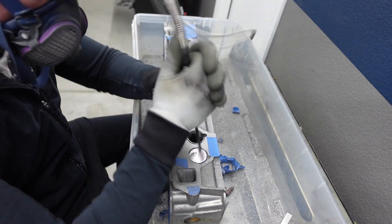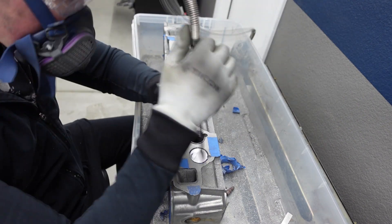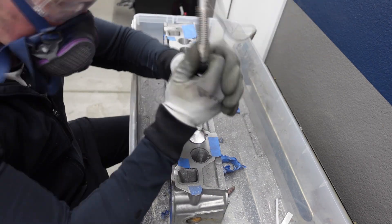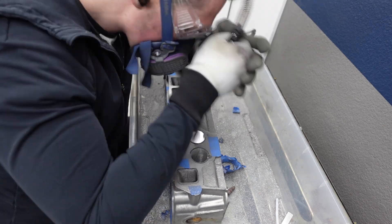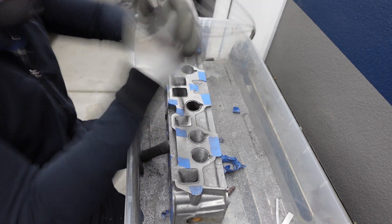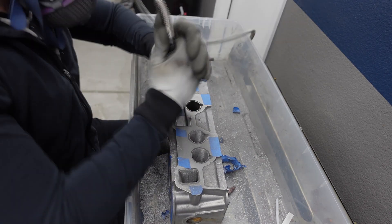At this point I had already finished six of the twelve runners and I really just wanted to get things done, so I was cranking up the RPM and going to town with a lot of force on the die grinder. That's something I learned — you can use a lot of pressure and you don't necessarily have to be so afraid about hitting water galleys, because there is a lot of material there. It's not endless, but there's a lot of material.